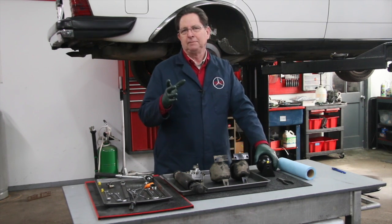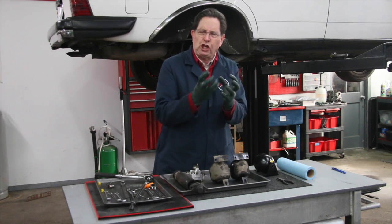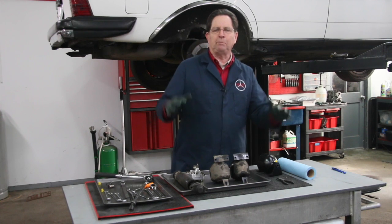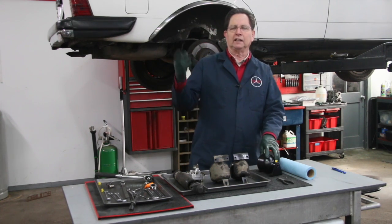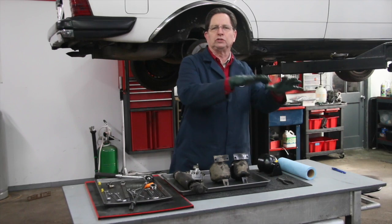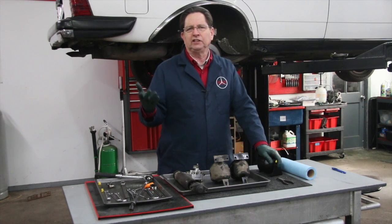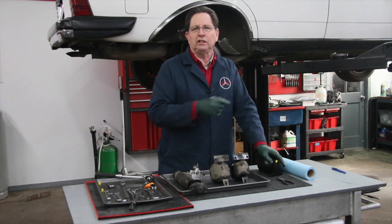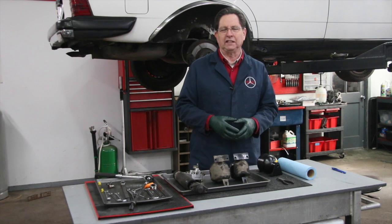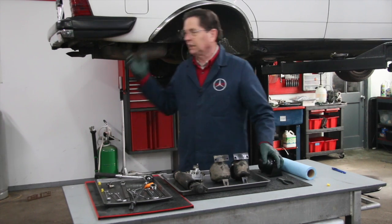What happens is these accumulators go bad over time. They start to leak a little gas and lose that heavy high-pressure charge inside the sphere. You'll start getting a bouncy ride, then you might notice you have to keep adding fluid to the reservoir. Pretty soon the car is riding hard, and this gradually happens over a longer period — maybe over a whole year. I think that's what happened with the owner of this car. He finally said it was too much, but probably two years ago he should have caught it. The accumulators got so bad he didn't want to drive the car, because at some point it becomes very uncomfortable when these fail completely.